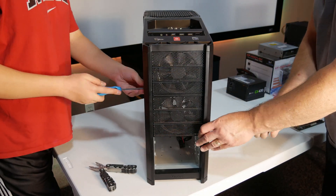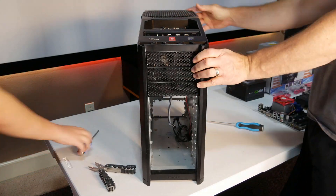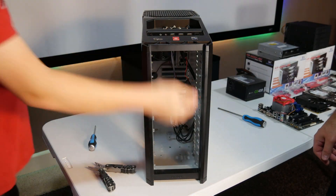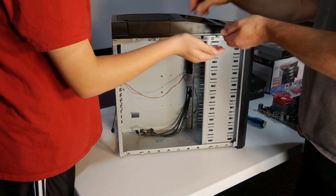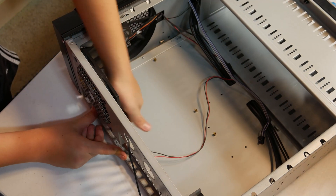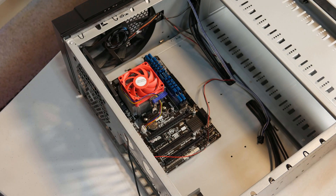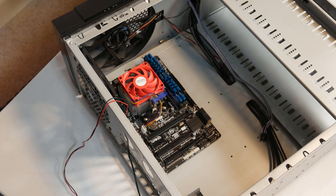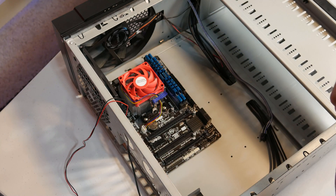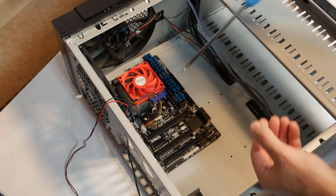The main reason we decided to go this route instead of just buying a NAS is because we have a ton of old computers lying around, so it really made a lot of sense to use the parts we already had, which ended up saving us a lot of money. In fact, the only thing we really had to purchase for this build was the SATA controller, because our motherboard only has eight SATA ports, which wouldn't be enough for all of our hot-swappable bays, Blu-ray drive, and SSD. We decided to add hot-swappable drive bays for convenience, but this project still works completely fine with any normal case that has enough drive bays for your drives. And as far as the hard drive goes, that's something you'd need whether you were to build or to buy a NAS.